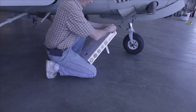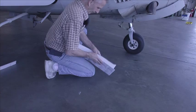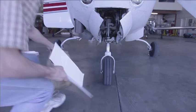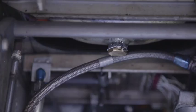It's located directly above the nose tire in a place where a drain bucket will not sit directly below, so you will need a way to get the used oil into your container. You can do this by making a simple trough from a flat piece of cardboard about 15 inches wide and 24 inches long. Bend it into a V-shape and then rest it between the nose gear doors and on a suitable container. The oil will flow onto the cardboard and right into the bucket.